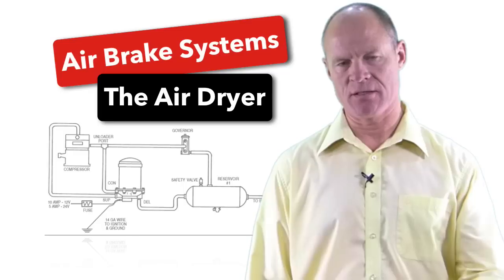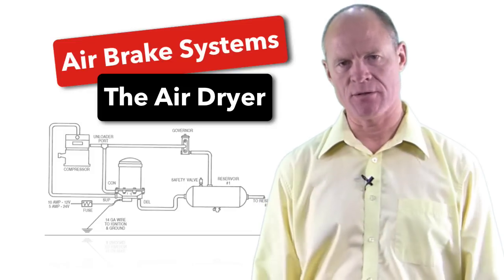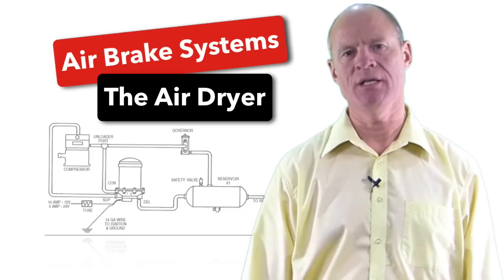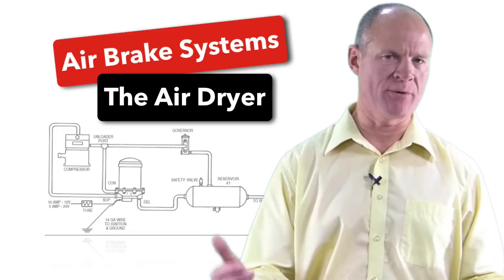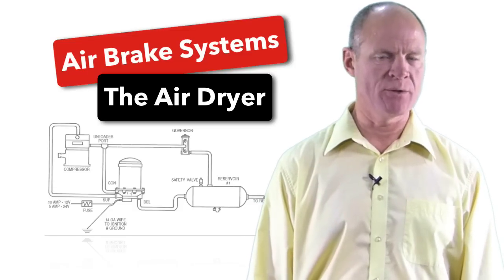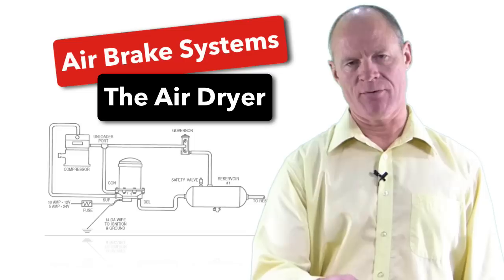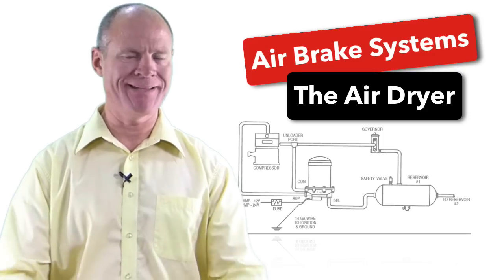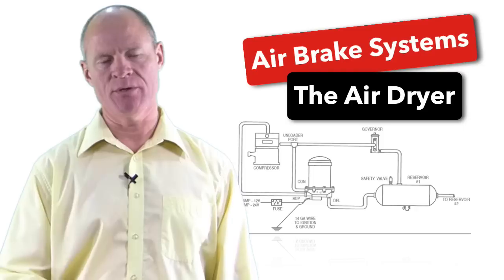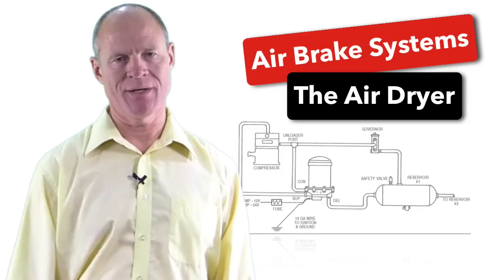The air dryer will be the indicator that the system is at maximum pressure. On an older system you're going to have a wet tank, and after you secure the vehicle by chocking the wheels and releasing the parking brakes, you're going to drain the wet tank. The reason you drain the wet tank first is to check that the two one-way check valves at the entrance to the primary and secondary tank are operating normally, as those valves are primarily responsible for the division of the air brake system. To locate the wet tank, note the air pressure on the gauges, then go out and start draining tanks — the tank that doesn't drop the dash gauges is your wet tank, because the wet tank doesn't have a gauge on it.